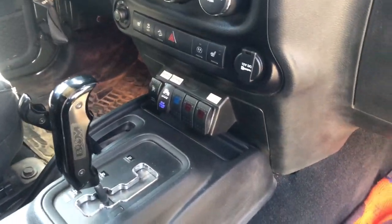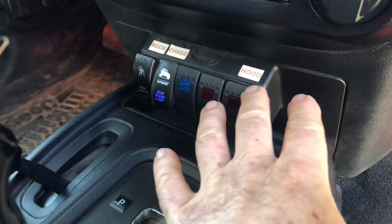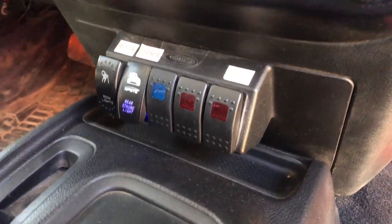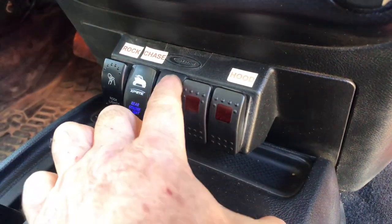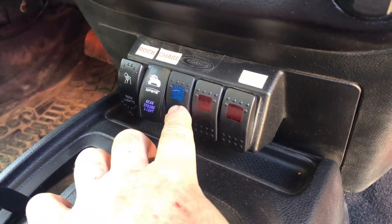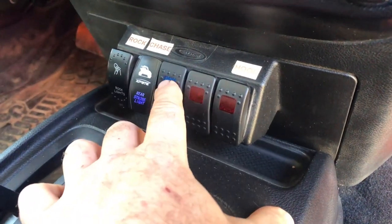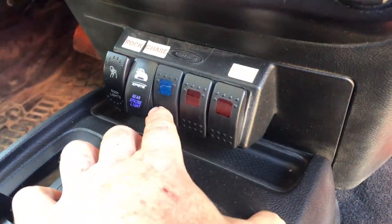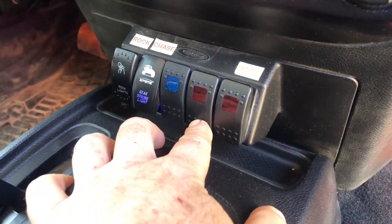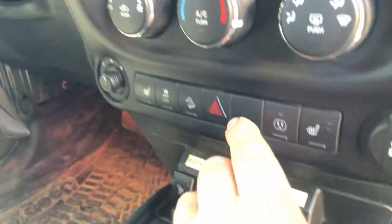What I want to accomplish today: I have this Day Star switch assembly here and I'm going to pull this out and access the wiring behind it. I have all of these switches pre-wired — even two that are not in use — all pre-wired to relays under the hood. My plan is to remove a switch; I've got a brand new one coming with a lockable cover so you can't accidentally bump it. You have to slide an orange toggle down, then you can close the switch. This will be my locker enable switch, and that'll still leave me an extra switch tied into a relay. I know I have 12 volts positive in there, fused, and I want to tap off that and run a wire over to the other side of the steering column.